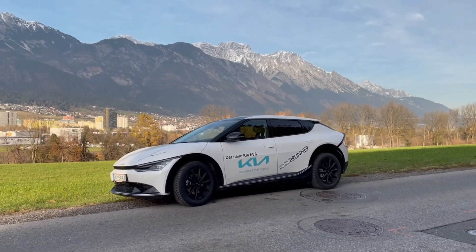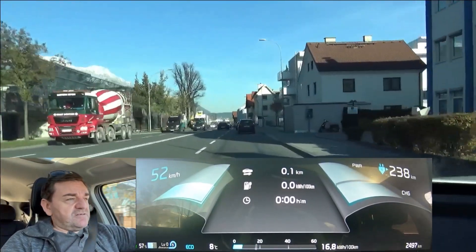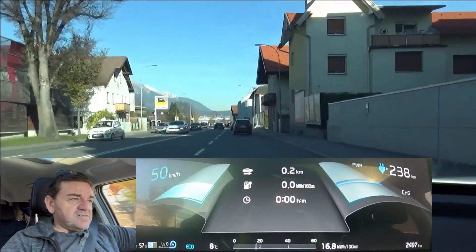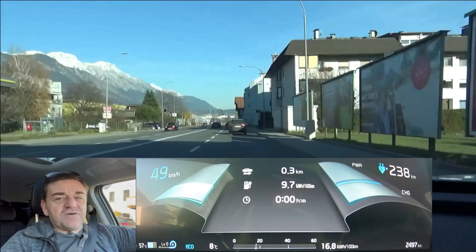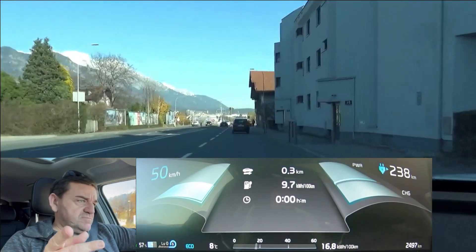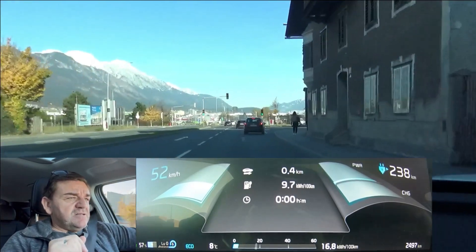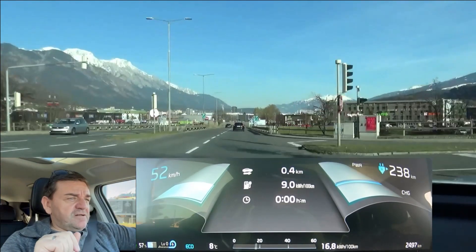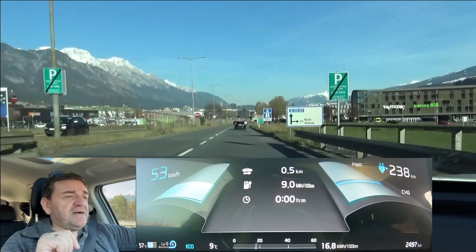We now try to find out what is more efficient: to recuperate as much or as little energy as possible. For that purpose I do four laps in town, about seven kilometers each, around four miles. The first two I try to drive with good foresight, read the road and try to avoid braking and therefore regenerating as much as possible. If I see a red light ahead of me I just lift my foot off the accelerator and coast towards the junction. Lap three and four I turn on the one-pedal drive mode and try to regenerate as much energy as possible and avoid coasting.